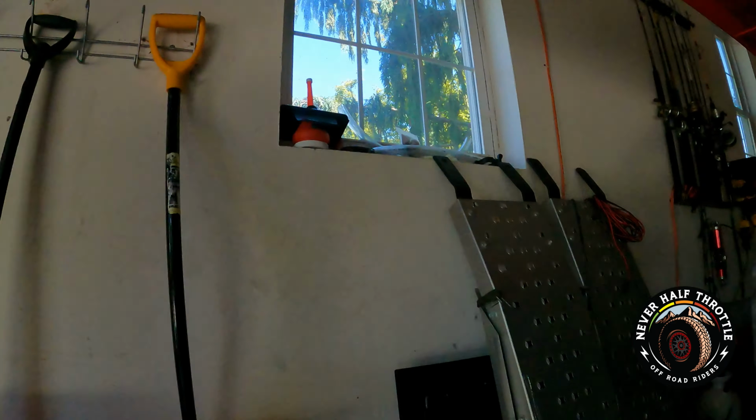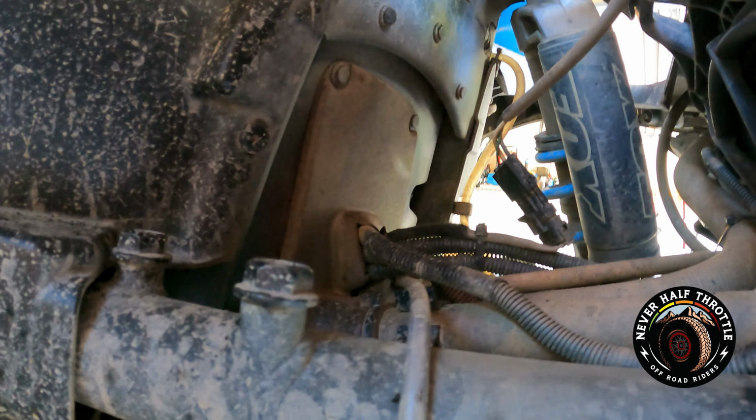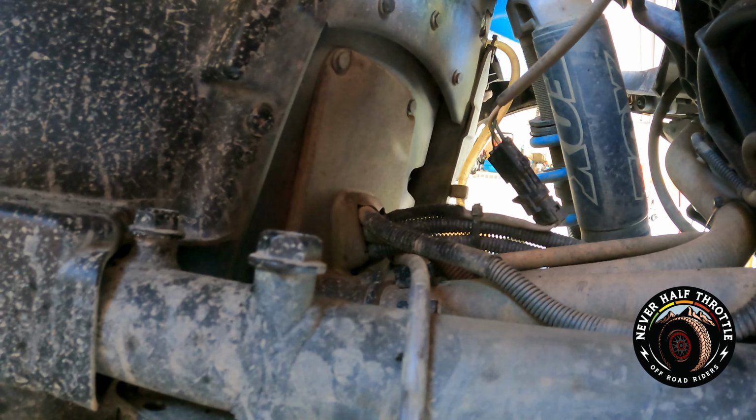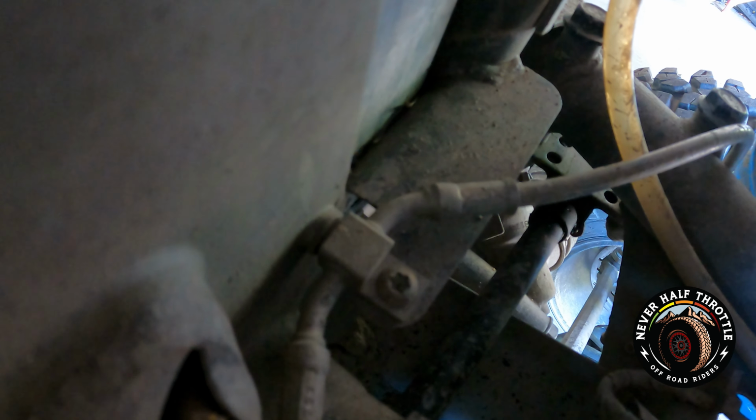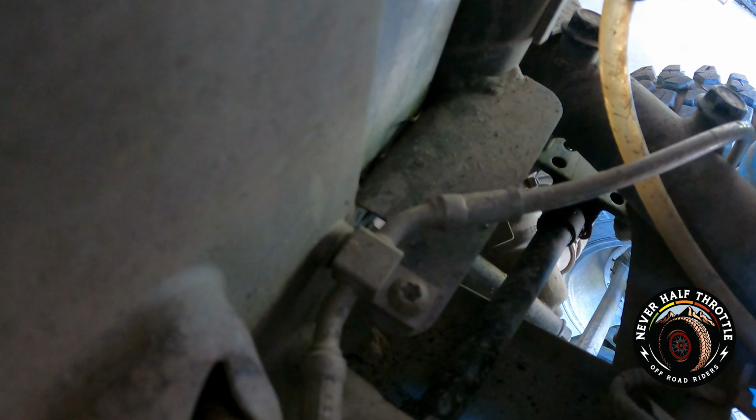We do have the brake lines that I showed you on this machine. It feeds right through the firewall, goes directly to the master cylinder, and it has a Y connector right up here. You can see that Y connector. I'll zoom in on it for you. There's the Y connector right there. It goes from here directly in. So the new part is actually feeding both wheels and goes directly to the master cylinder. So that should be a very easy fix.